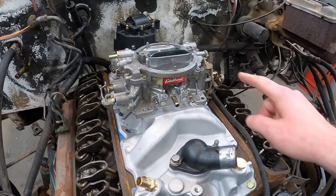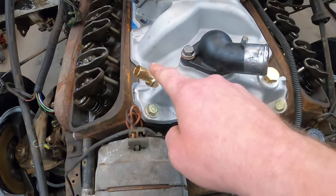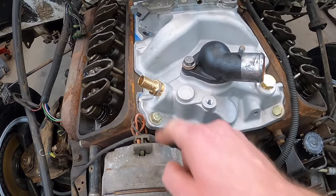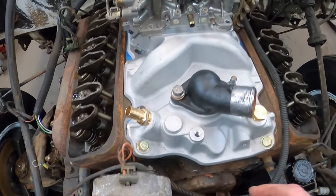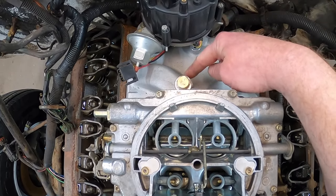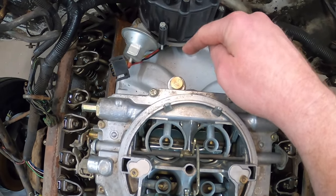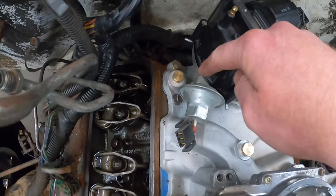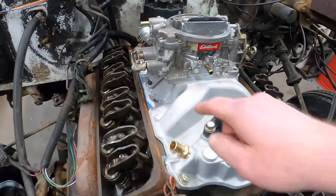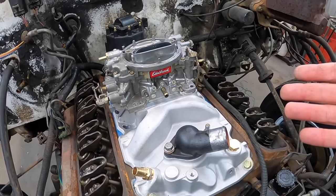Got the carb stud kit. Still got to reuse the water neck. I had to put some plugs in — so a water plug, this is going to be our new heater core hose, a five-eighths barb to pipe thread for the front here. Looking back here, we've plugged up these ports. This one has hydro boost brakes so I don't need a vacuum port there — just plugged it. And went ahead and deleted the heat riser thing, because we don't need that.